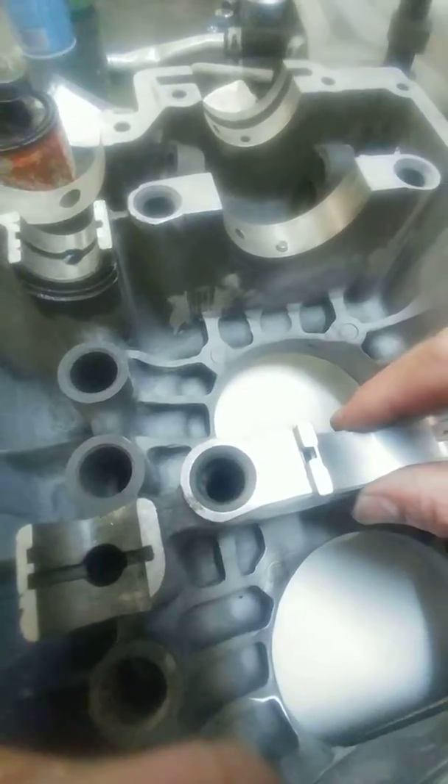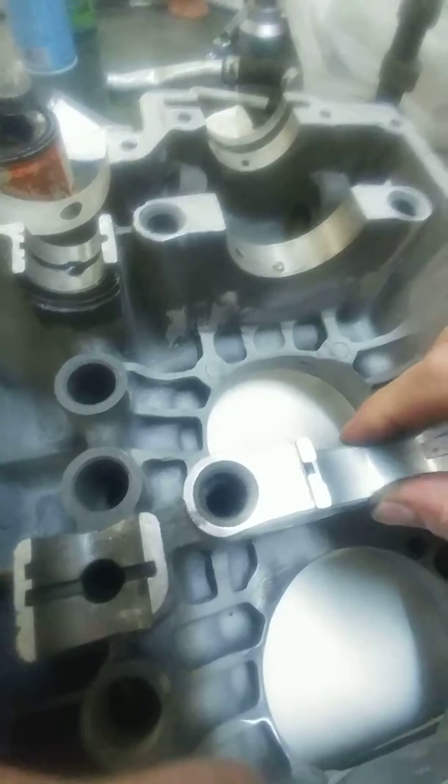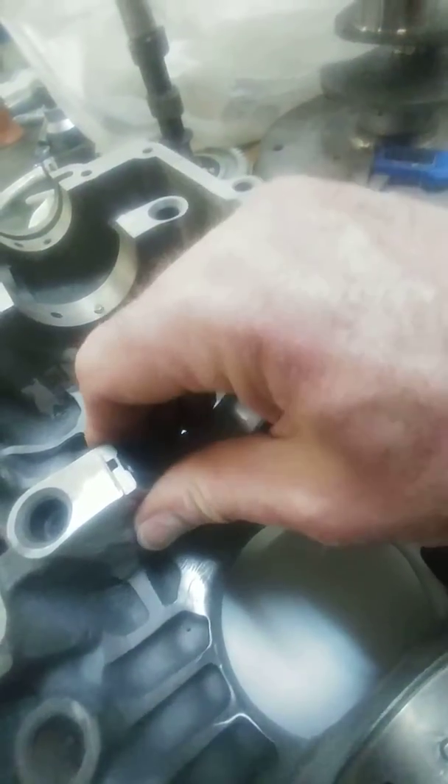I like to make sure normally that I use both thumbs and push this down from the parting lines down into position. Because I'm holding the camera it's a little difficult. What I want to do is make sure I press right where the oil hole is, because I can't create the radial pressure unless I torque the case halves together - that's a lot of additional work - but we're going through this step anyway to make sure we've got good oil flow. So I'm going to get this bearing out of here in a moment.